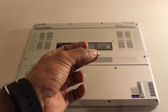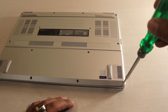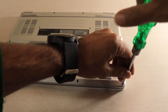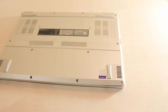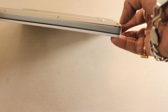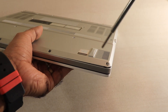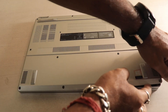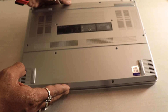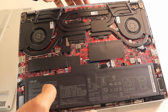Keep these small screws in a separate place so they don't get lost. I've already unscrewed and removed 13 of the Phillips head screws. This one particular screw will not come out — even when it's fully unscrewed, it stays in place. The reason is that as you unscrew it, the back cover actually starts to come off from here, helping you pull the cover away. So it's a nice addition. Now I'm going ahead and pulling off the cover of my Asus Zephyrus G14.